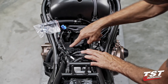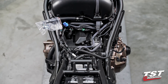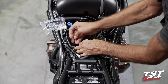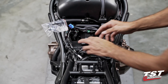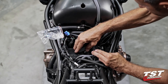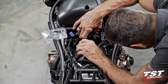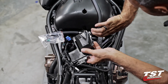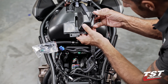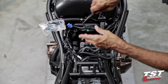Now we've exposed these two push fasteners — they need to come out. Same as the front panel push fasteners: press them down, that unlocks them. Now this panel can be pivoted up a little bit. There is one more feature that holds this onto the receiving box that I can't show you until I take it out. This window has a clip it interferes with — the clip is in this direction, so we need to push it up, forward, and then come back out with it. That comes out.